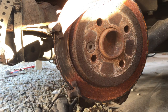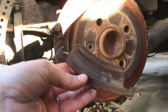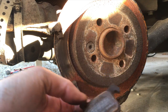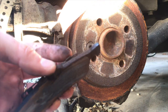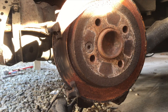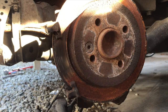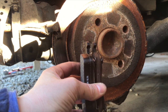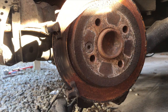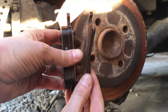And we're off. Not much left on those pads. That one was definitely our problem child. Let's see what the back one looks like — that one is down into the backing plate. That guy's done. Let's put some new ones on there. I'll show you the difference — these are the two backside new and old springs. The springs are even smashed. There's your difference in thickness of the pad — there to there. And that one doesn't even exist. That ought to make a difference.